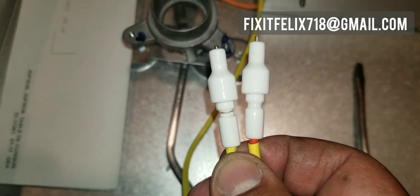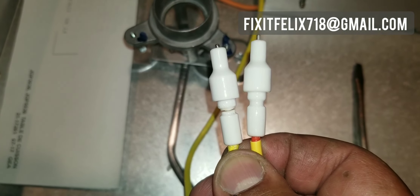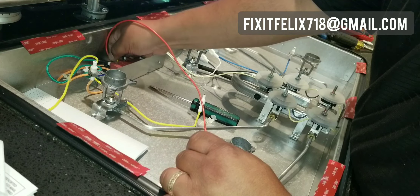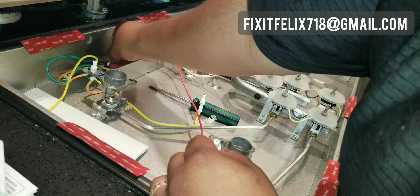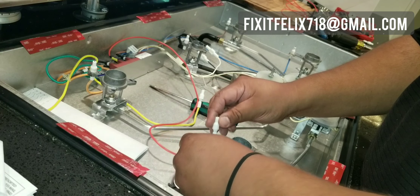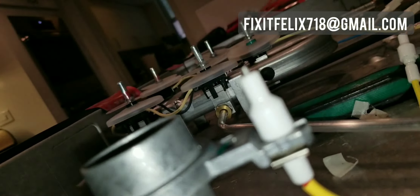The new one is intact, so I'm going to install this new one. GE sells a harness for this, but it was back ordered. I was able to find a similar looking sparker that's exactly the same — I ordered that, it was only six bucks. So I pop it through and push it down, hold it straight, take that clip and clip it right on. It snaps.